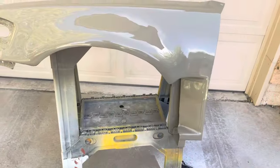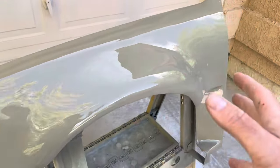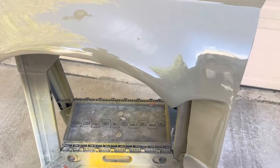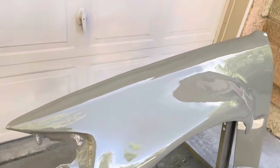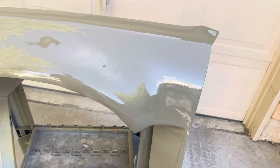So here it is. Since then I did two coats of high-build primer, about a coat and a half of actual base — I kind of ran out of base and I have a hold of a can but still want to open it — and then three coats of clear. You can see it's not terrible, but there's definitely some orange peel. Not the end of the world. I do want to do the black stripes. Right now I'm just going to wet sand this with 1200 and work my way up to maybe 2500 real quick.